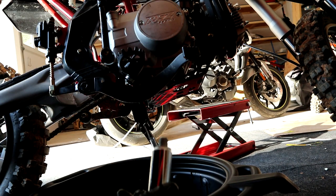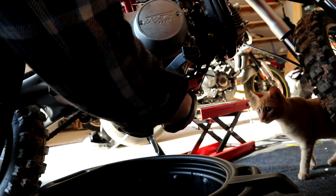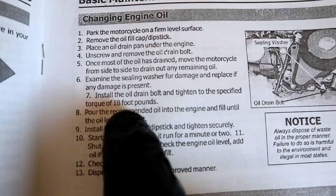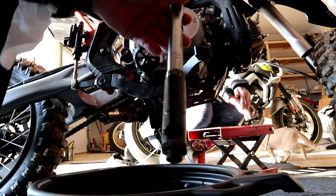We're going to put the screw back — make sure that it's not dirty. It'll actually be easier to put it with the socket in hand. We have a little cat joining us here. Installed the drain bolt to 18 foot-pound. I actually happen to have a torque wrench — I got this to 18 foot-pound.